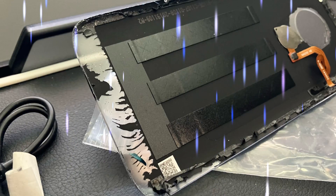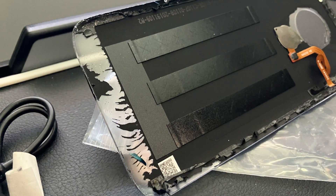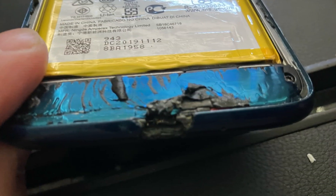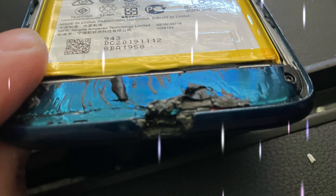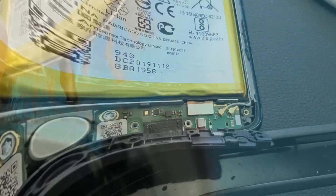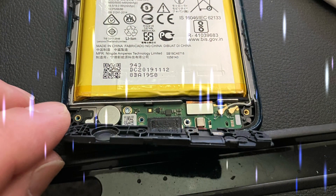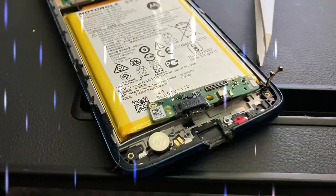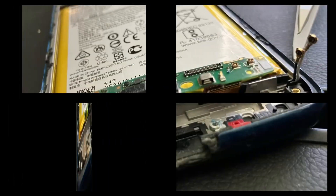So this is after I got the glue off and got that back cover off. There will be immediate damage — this colored film that you're going to scrape up and break. It's not going to look as good when you finish. But that's where the flaw is: that plastic is so thin it breaks. What happens is your charging cord yanks on the charging port and breaks off the plastic, and probably moves or breaks pins off.